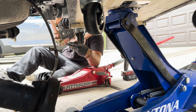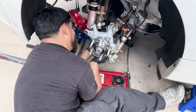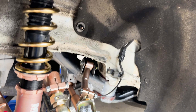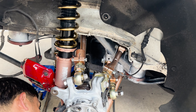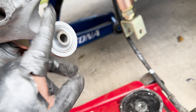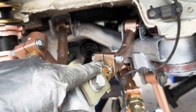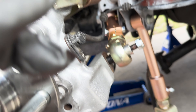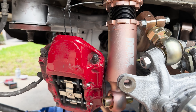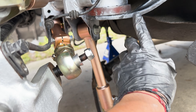We need a shop, we need a lift. This one goes here — it's the lower traction rod, if I'm not mistaken. Upper traction, upper control arm, tie rod. Things look perfect though. This feels tricky because the bolt is there — you just want to put that in first.